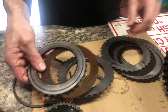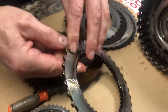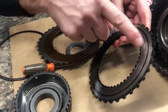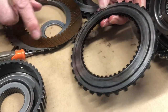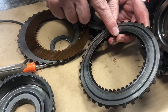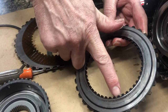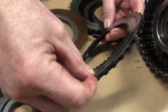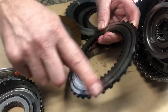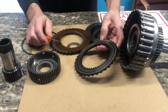What we're looking for here — these two clutches right here. You can see that the clutches had been hot, but this one here actually doesn't have any material on it at all like this one does. It has completely burnt the material off of it. It got hot — probably got stuck in mud. The way the truck looks, it looks like it was hung up in mud. When it does this, it welds itself right down metal to metal to your steel. Once it does that, it's going to start pulling forward in all gears.